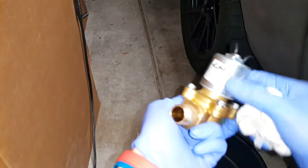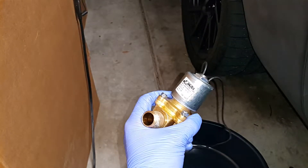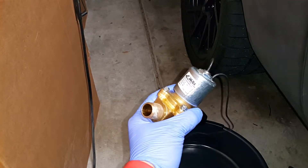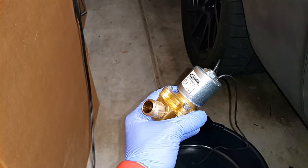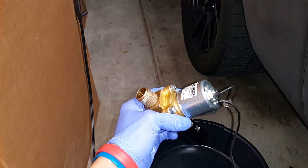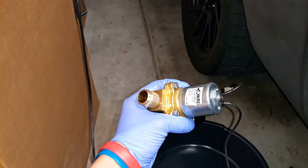This particular unit failed on me though, because when I would run it — normally my engine is at 80 to 90 psi like I said — and then when I turn the engine off, it drops down to zero. So I called Canton about that and they said there's a diaphragm in here that probably ruptured, and I'm just curious to see what's inside.